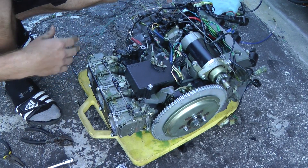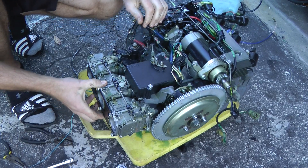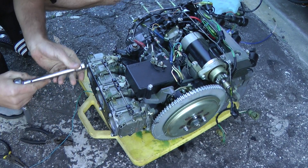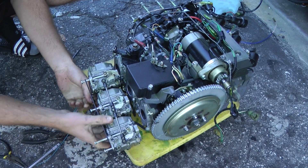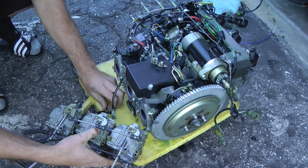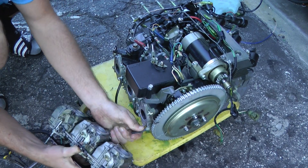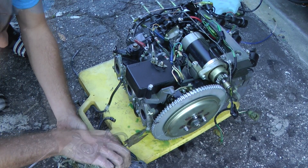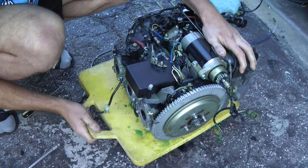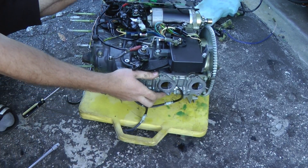You want to follow this blue wire and disconnect it right here — just pull it. Now get your 10 millimeter and start wrenching on the carburetors. After you get the last screw off the carburetor, it looks like there's one more hose — I think it's a vacuum hose leading to the engine block. Disconnect that, and after you take the hose off, your carburetor should come right out. Now we can proceed to finishing the disconnection of the oil injection assembly.